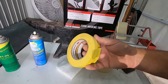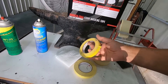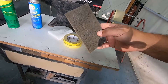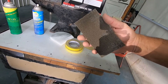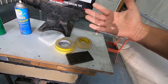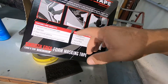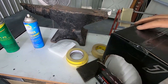We have some automotive grade masking tape — don't go to the dollar store and buy the cheapest stuff. I've got inch and a half, three quarter inch, and I'll use some two inch later on. I always keep a gray scotch-bright pad equivalent to 500-600 grit to scuff all the edges, because I didn't do that while sanding the outside of the car. The edges have to have a scratch so that even overspray will stick.